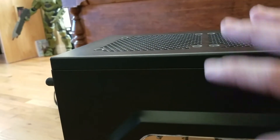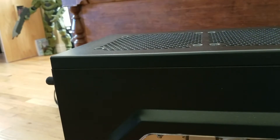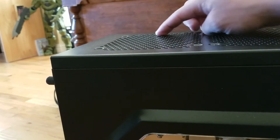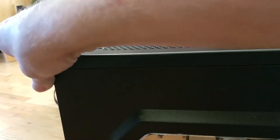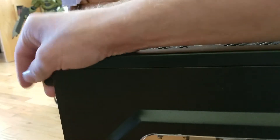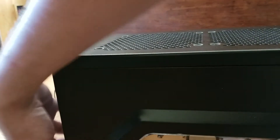We're just going to slip it over the top and screw it on. The reason why we can't have another 120mm fan in the other spot is because the CPU power cable that connects to the motherboard is right back here in this area, and that prevents me from screwing in another fan because it pushes the fan forward. I could just get a cleaner cable, however, but — I'm kind of lazy.